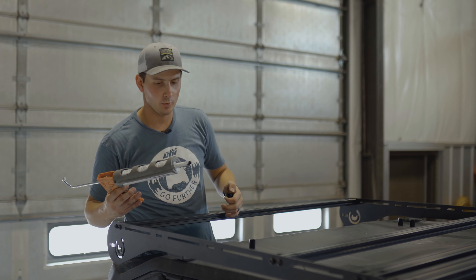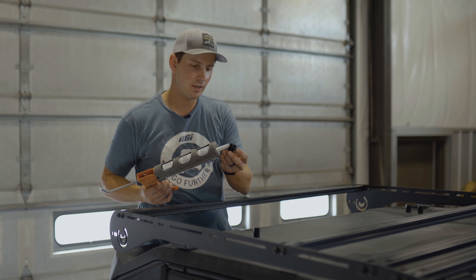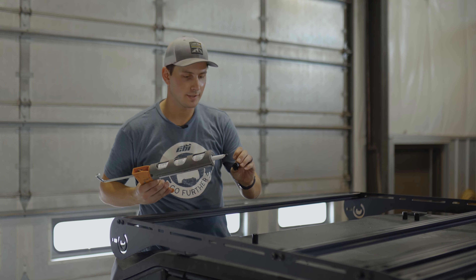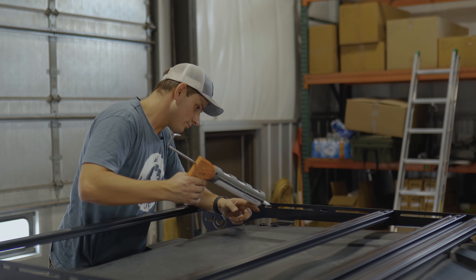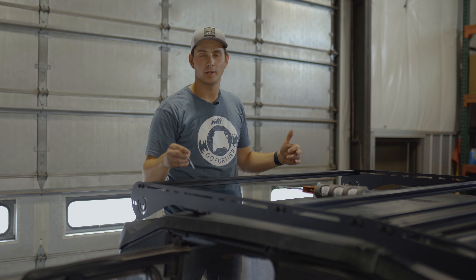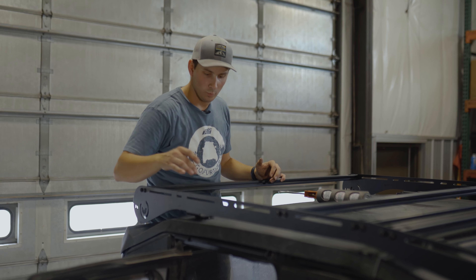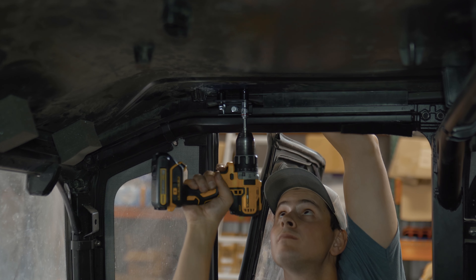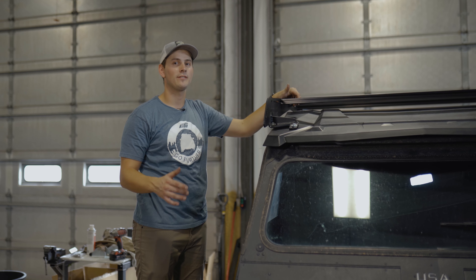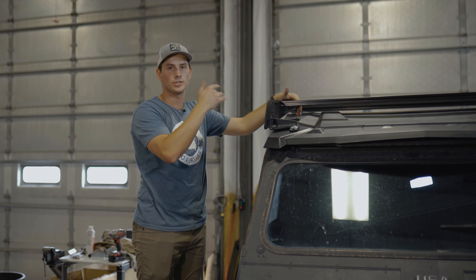Now that we have our holes drilled, we're going to go ahead and put in our spacers. I like to put a ring of silicone around the top of the spacer before dropping it in so it seals itself, and I don't have to worry about working around the mounting feet to apply silicone later. With spacers in place and silicone applied to keep water out of the cab, drop the carriage bolts in through the top and tighten them on the backside with the nylon locking flange nuts. Then tighten the front two feet, finish putting the rest of the rack together, and attach the bracket on the back of the roof to the vehicle. That should just about do it.